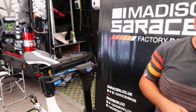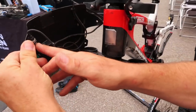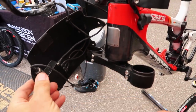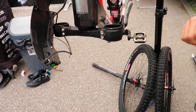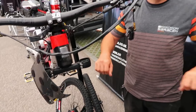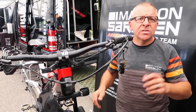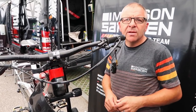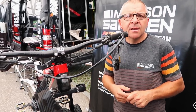Up front we've got this upper sensor, and that measures Danny's input to the bike — how much he pushes through on the front, how much he's loading up the front end of the bike. Which is another great piece of information, because we can measure dive independently of anything else. If something like that's going on, we either add a very small amount of air pressure or some low speed compression damping.